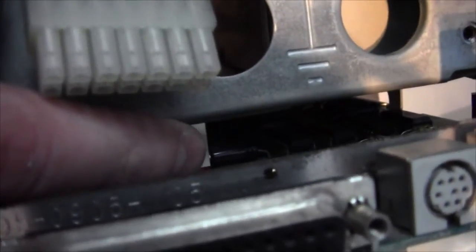Okay, just a small warning if you're thinking of doing this, because I've been struggling, to say the least. Now, see that little white thing there? That is a plug that came off as I pulled the motherboard out. It's a cable that goes down to the front. It looks like it powers a speaker or something. But it is a pain to get back in, because when you push the board fully in, the hole is right off to the side, and unless you've got the world's most dexterous fingers, you can never get that back in. So I've had to pull it tight, push the motherboard in, and just get it in as the motherboard goes in. It's just long enough to do that, but even that is a struggle. So that's just a warning for you. If you're contemplating this, you may have trouble.